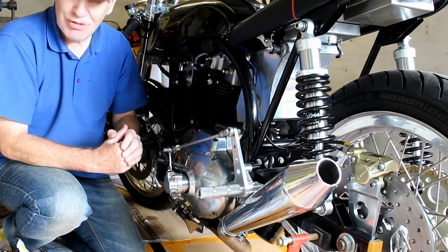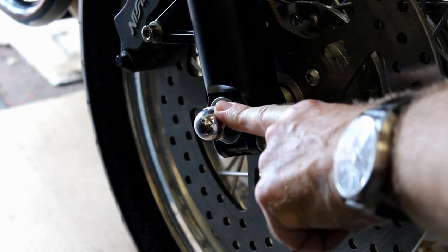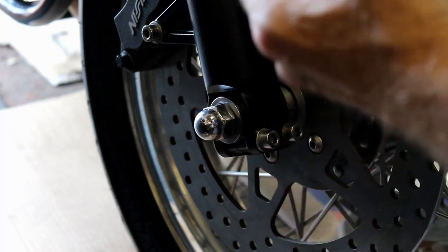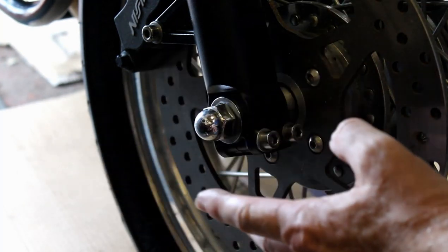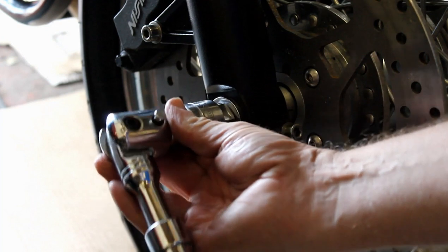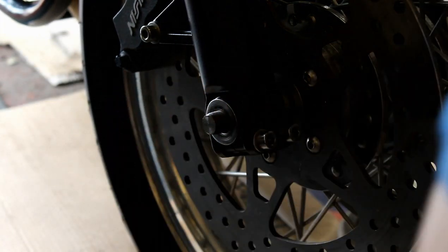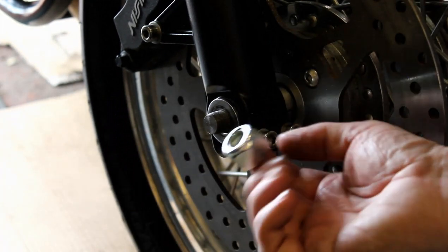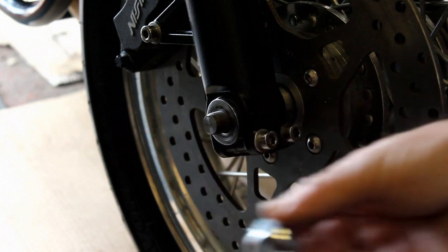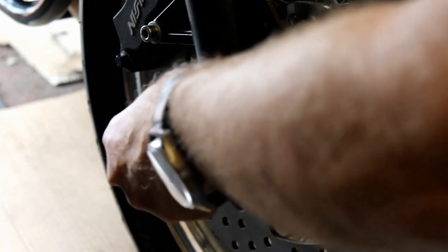Before I do that, I've still got plenty to do. Next is a very small upgrade: replace this chromed dome nut on the end of the front axle. I don't like the dome shape, and the chrome is now peeling off, so it's got to go. Let's quickly remove it — it's bloody tight, so here's my big extension bar. I'll replace it with one of these simple cadmium-plated nuts — it's three-quarter UNF.